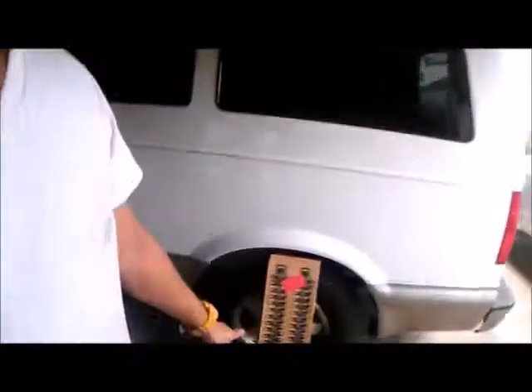What's going on, Rob here, Trev 2323. Yesterday I shot the video on how to loosen the bolts on a 2002 Chevy Astro van LS. My shocks came in today — these are the Monroe Sensa-Trac heavy duties. One thing I wanted to show is that leaf springs are what actually hold up the vehicle, so you can take the shocks off with it sitting on the ground. The Haynes manual says to pick up the van, but it doesn't say whether to lift from the axle or the frame. Also, these '02 Astro vans develop what people call 'ass sag' where the rear end sags.